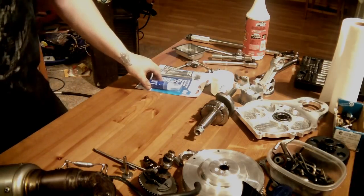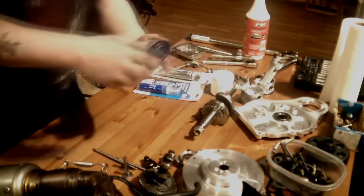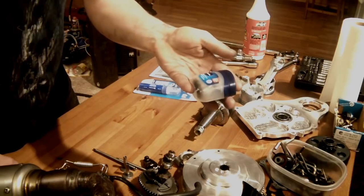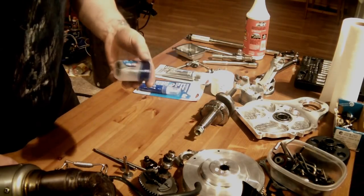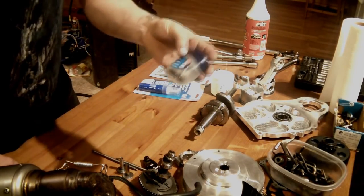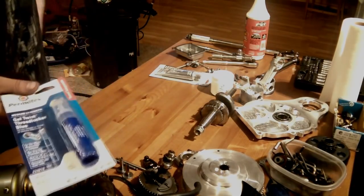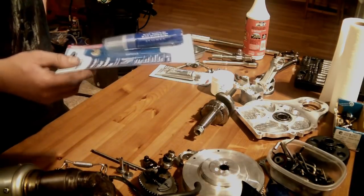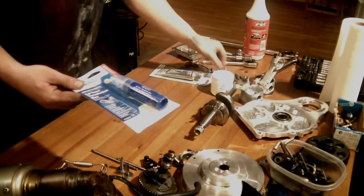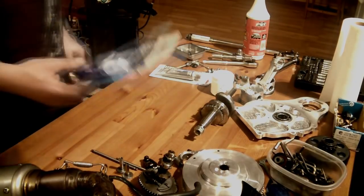You will need stuff for liquids and assembly. I like to use Vaseline, or any sort of assembly lube. This is nice because small parts that slide in and need to stay put — like the lifters — a little bit of Vaseline holds them in place so they don't fall out. You also have to have Loctite, especially for a paramotor. I usually use red, but red is a pain to get out when rebuilding. So I'm going to try blue this time — it should be just fine.